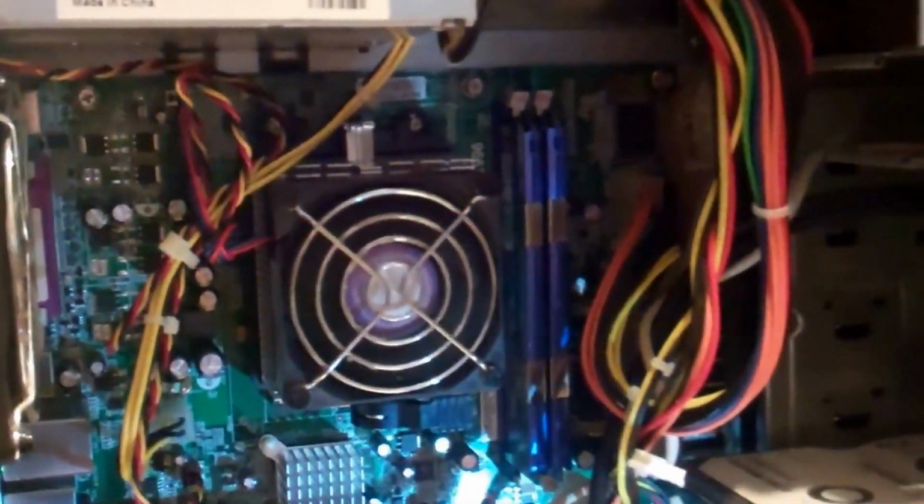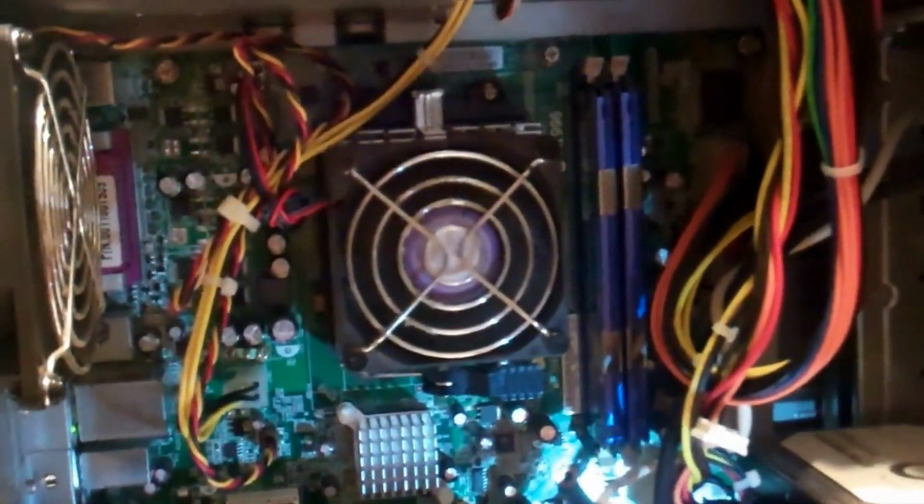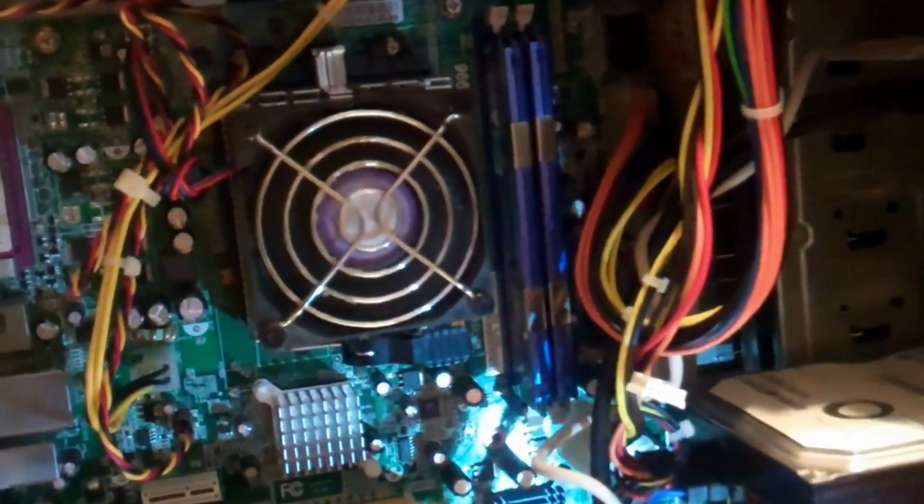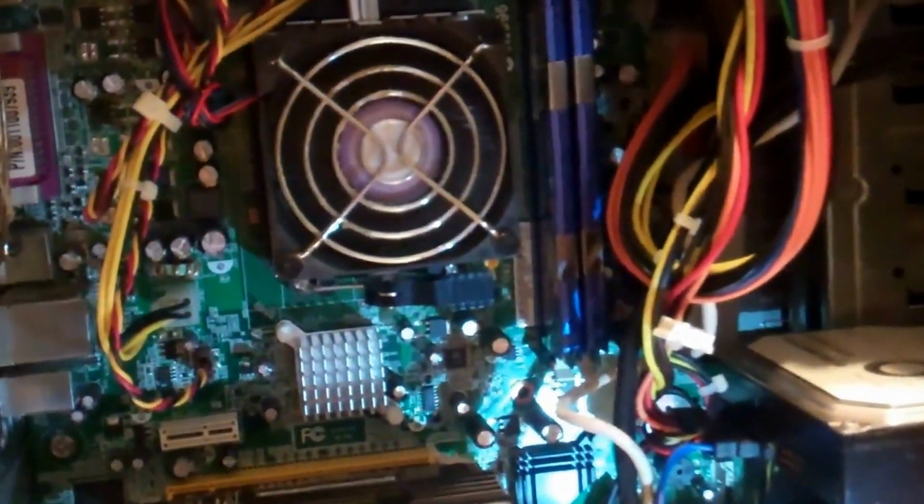But yeah, as I said, I've actually paid $40 for this motherboard, the MSI AMD Athlon processor. 4 gigs of RAM, and yeah, the old one originally had some oxidation. I don't know if it had been exposed to water or whatever, but yeah, the motherboard was shot. The capacitors were starting to bubble. A few of them actually popped, and when my buddy was trying to repair it, the solder was just not taking to the capacitors when we'd get some new capacitors, or he had some on hand that he knew would work, and they weren't staying put. So it became more of a hassle, and I just searched around for another motherboard and just told him to scrap that one. So yeah, that's what he did. You know, got this motherboard a couple months back. So, but it's working good, obviously, especially with Windows 10 and the MSI 5450 video card.